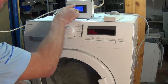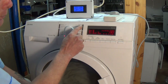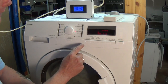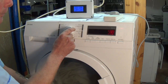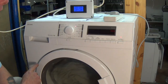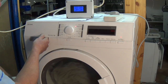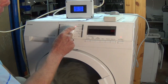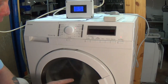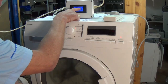C1, which we're in at the moment, shows you that all the lights are working. C2 is the pump at the back of the machine which collects the water and pumps it up to the dispenser. C3 is anti-clockwise rotation with the pump running as well.